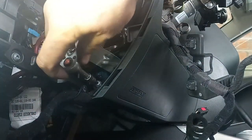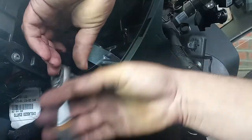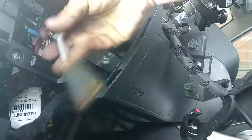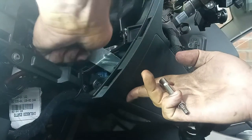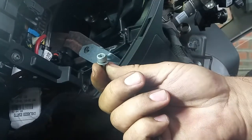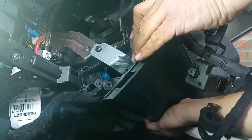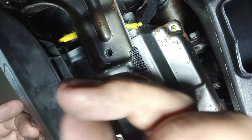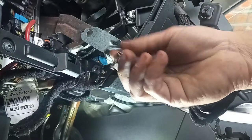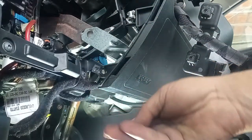There is a T25 screw here and a 5mm on the wrong place over there, or perhaps a washer is missing. I will add a washer here — this is very odd to me. It has one but it is too small. Strange, maybe the bolt is not from there. There is one more bolt on there — 5mm — holding the airbag. The screws may be backwards because this one has a larger washer; maybe it belongs on the underside.